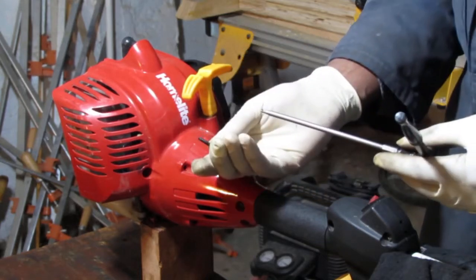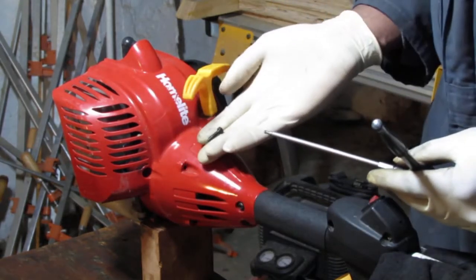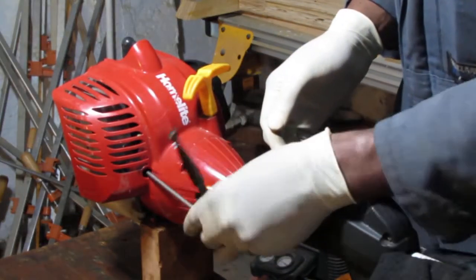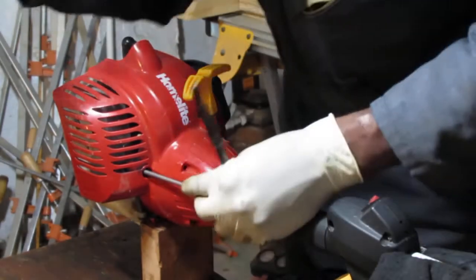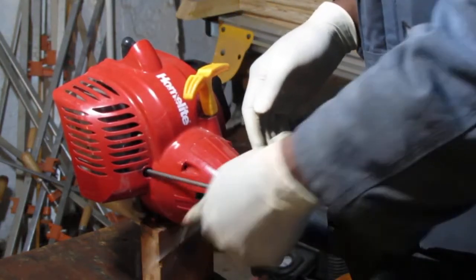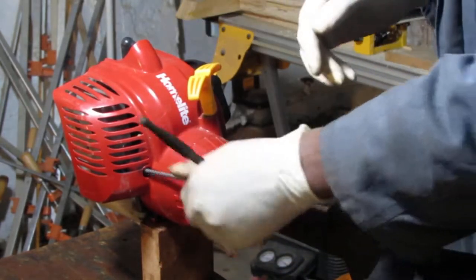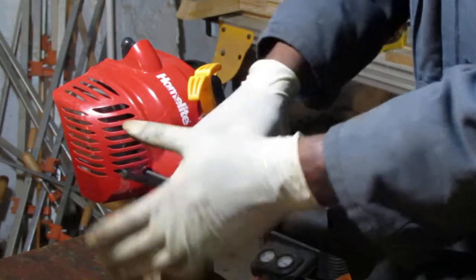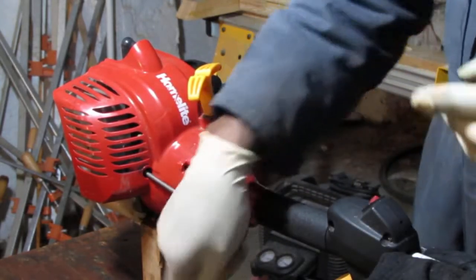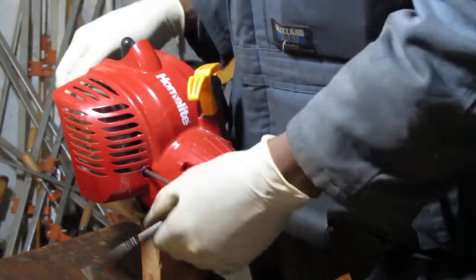Okay, this one goes into metal. Okay, that makes sense. It's a thinner thread, sorry. Yeah, this screws into metal too, so it should also be like a much smaller pitch angle. I'm sorry, that's a little redundant. It's going to be a smaller pitch on the threads, or higher thread counts per inch, because it's going to go into metal.